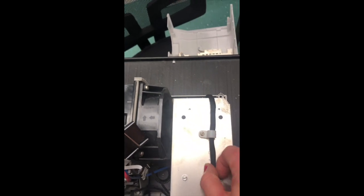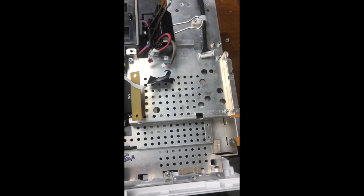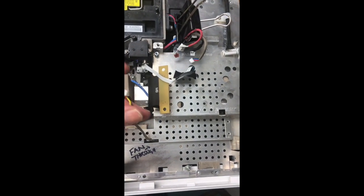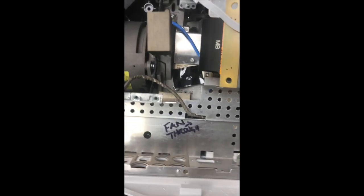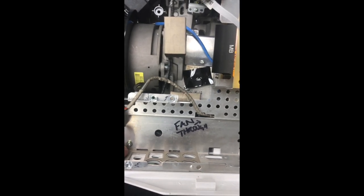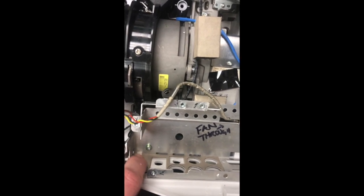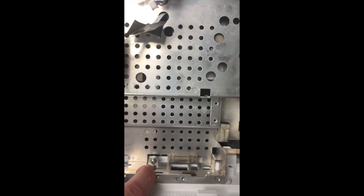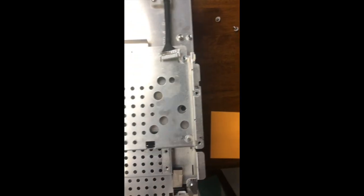With the bottom plate in place, put in a few screws. Make sure the silver-coated fan cable is coming through the center. There's a screw there and you have to line up the nub to make sure the plate goes all the way down into where it needs to sit. Then the other screw — this screw can go on this corner or the corner by the bundle of cables.